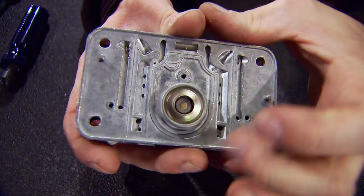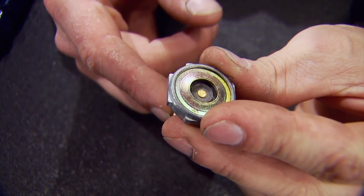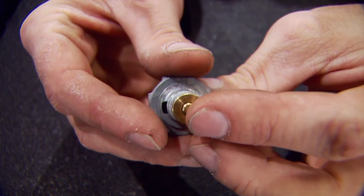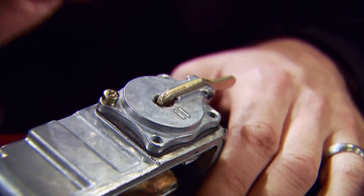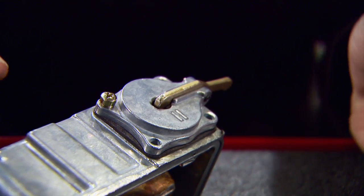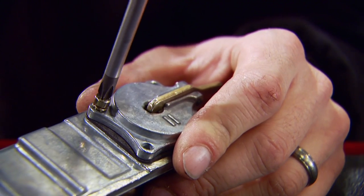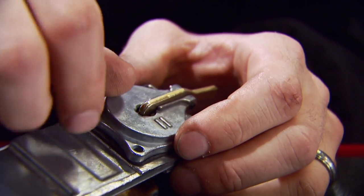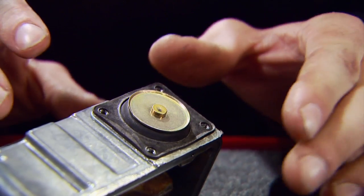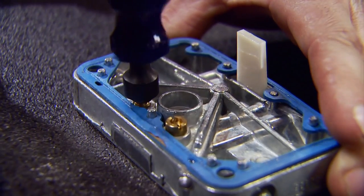All primary and some secondary metering blocks have a power valve — it's basically a vacuum-operated mechanism that opens on power demand. You can change at which point they open, measured in inches of vacuum. Power valves are available in the 2.5 to 10.5 inch of vacuum range. The accelerator pump is located on the bottom of the fuel bowl and has two basic jobs: the first is to prime the engine prior to cold starts — though too much priming can flood the engine. The second job: as you put the throttle to wide open quickly, airflow increases faster than fuel flow, so a lever and diaphragm force more fuel into the throat of the carburetor to correct that lean condition. The main jets control the amount of fuel introduced to the Venturi.